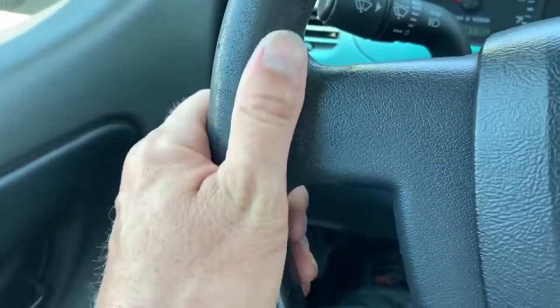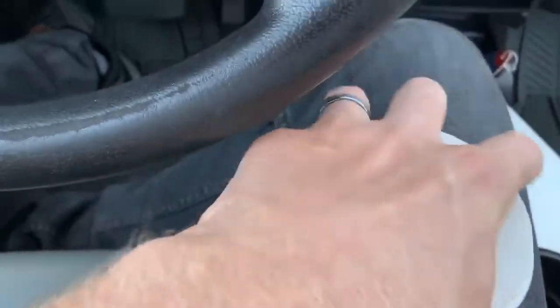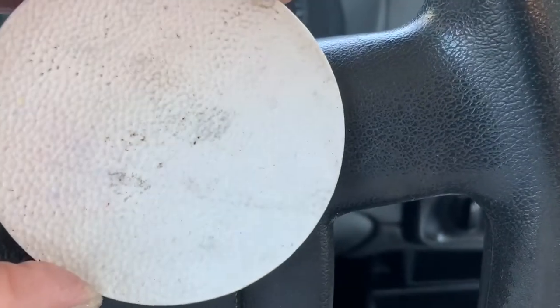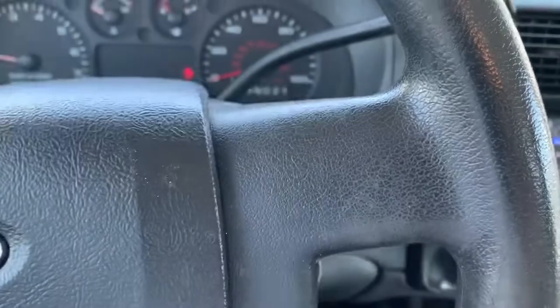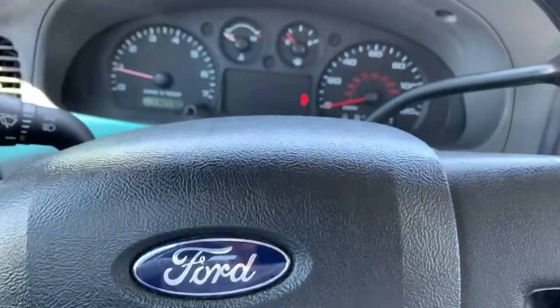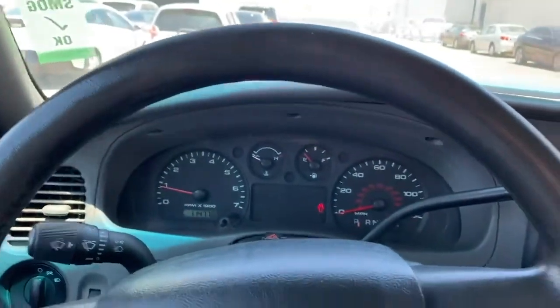Basically what I'm going to do is use one of my graining pads. We have all these different graining pads here. I'm going to find the grain that matches this the most closely and then re-stamp it so that it looks like it's there. I'm going to heat the panel using a miniature blowtorch — one of these guys — and basically melt this back down and then press in my grain.